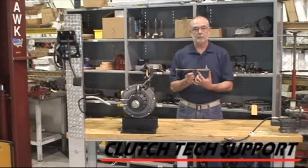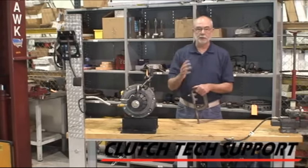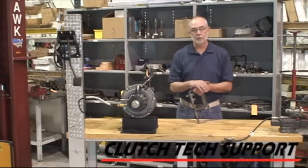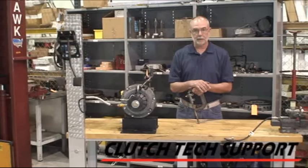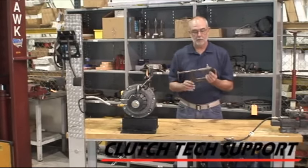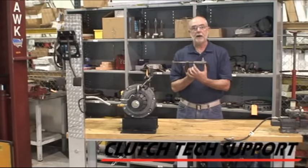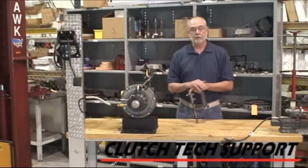Blocking the slave cylinder from extending. A lot of times we get into the vehicle when it's time to bleed the clutch, somebody pushes the pedal, you open the bleed screw and nothing really happens. You don't get much air out, you don't get any fluid out, and the frustration starts. But if you change the system — if you take a look at it and ask: will this system allow me to safely block the slave cylinder from extending? Now we're going to change the dynamics of this entire process. Let's take a closer look at how we can block the slave cylinder and bleed a clutch hydraulic release system.